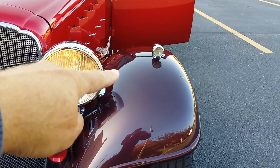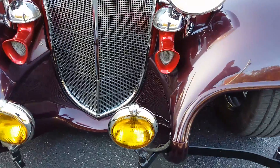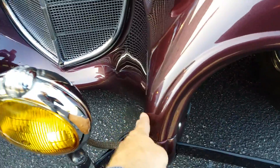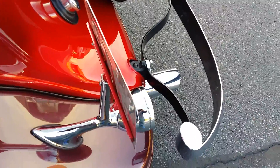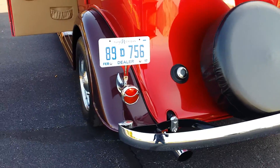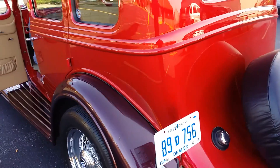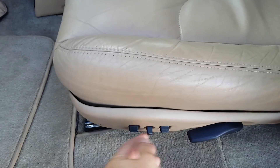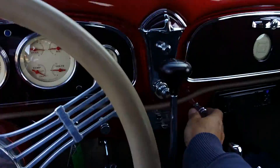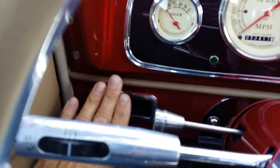Entry lights seem to work. Headlights — check. Turn signals — check. Brakes — yep. Got a rattle coming right there from that fender; might need a bolt secured on it. License plate light — check. Turns and brakes — yep. Brake lights, brake lights again, third brake light. Now that we're running, the power seat works. Wipers — yep, there we go. AC is on and blowing nice and cold — I don't have my digital temp meter with me but I can tell that is much colder than the outdoors. Engine's warming up sufficiently now, running pretty cool, holding 50 pounds of oil pressure still.